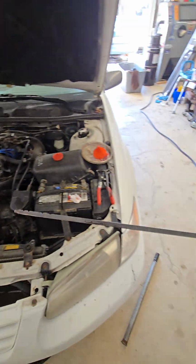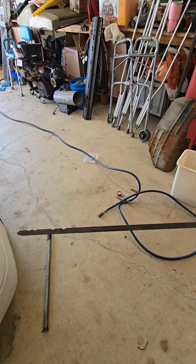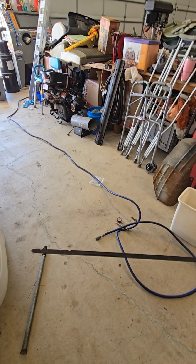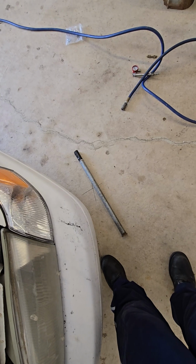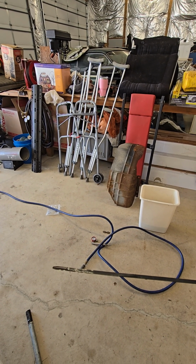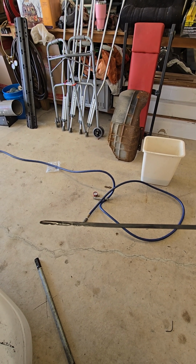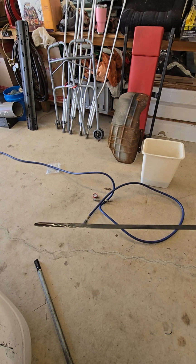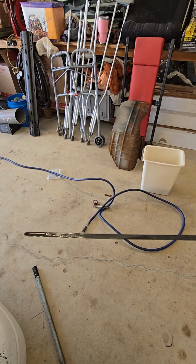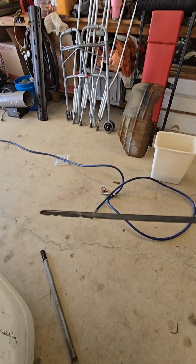So just to correct that, you want it in between those 2 sets of notches, one for hot, one for cold. You want it in between those 2 sets of 2 notches. That's all. It's maybe a little bit on the low side, but one thing I didn't do yet is go through the gears. That's one thing you want to do: run through the gears, low, second, drive, reverse, all that good stuff. It gets all the fluid going through all the valve bodies.